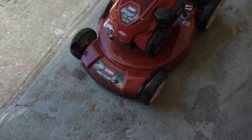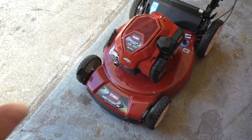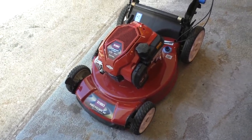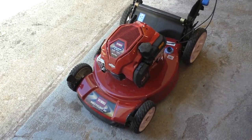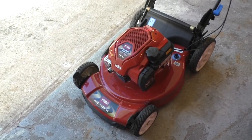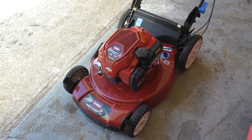It's kind of a tongue-in-cheek 'you don't need to change the oil — it's modern technology, we use synthetic oil, it never needs changing.' Listen, if you buy into that, you're going to screw yourself in the end. If you're expecting a good long ten years out of this machine and you never change the oil with a reasonably sized lawn, you will seize the engine. Even if you keep topping it off, it will progressively begin to burn oil. That is how it works.